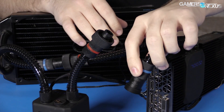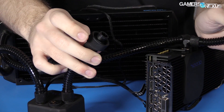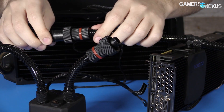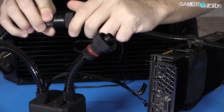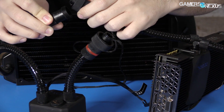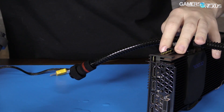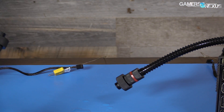You should also expect a few drops of liquid to leak out during connection — this is normal. We'd recommend putting down paper towels as safety and then running a leak test prior to full operation. Speaking of leaks, during connection to our Ice Bear 280 unit, we had an issue where the cheap plastic locking mechanism and its spring popped out of the valve as a result of the aforementioned slipping threads when you tighten them just to be sure. Fortunately, we held the tubes up when installing, so no fluid was lost to the board where it would matter. Just be careful when connecting everything.